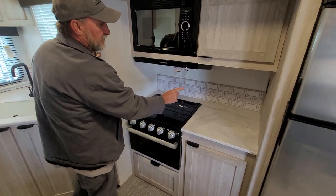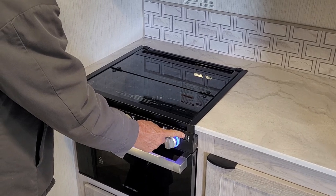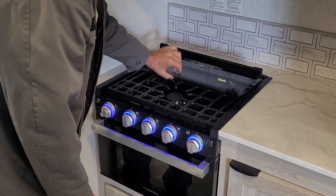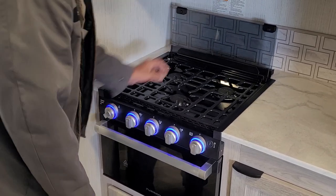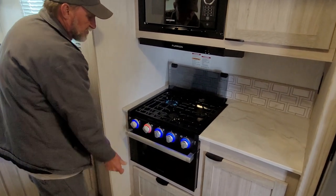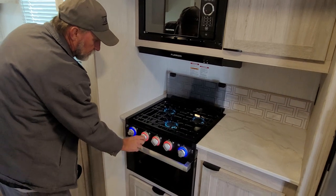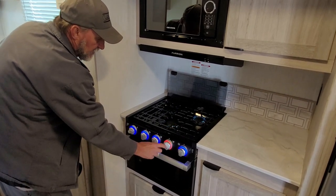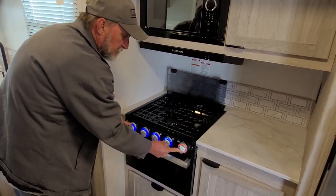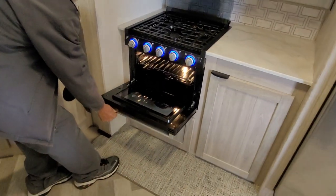On the stove vent, you do have a fan and a light switch. On the cook range, there is a light switch on the right-hand side that turns the illumination lights on and the knobs on. Fold the glass stove top up twice out of the way. You turn the gas button to where it says pilot on, using the striker on the left-hand side to light all three of the top burners. When there's gas coming through the knobs, they turn red. On your oven, when you turn it to pilot on, you hold down the button and use the same striker up on top to light the oven. If you flip the switch on that light to the bottom position, you also have a light in the oven area.